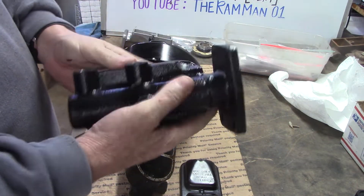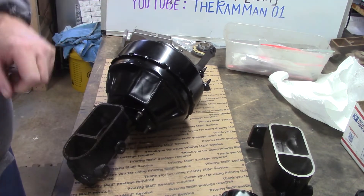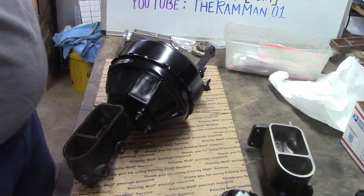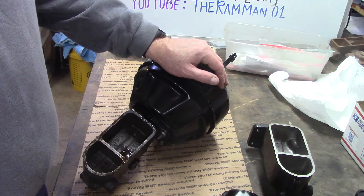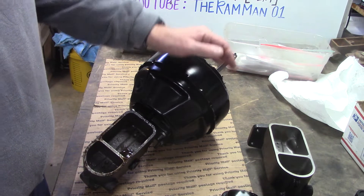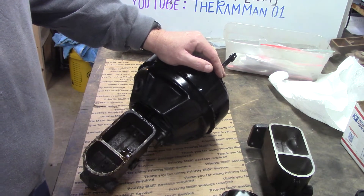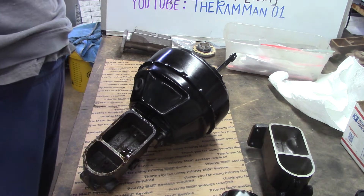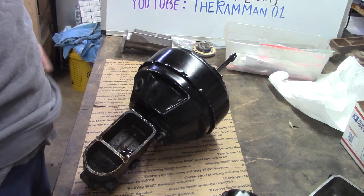Moving on from that, we have the Bendix Tandem Bendix Booster. What does that mean? That means there's literally two boosters in here piggybacked on each other. This Bendix Booster was introduced in 1962 on the Imperials. The Imperials used a great big inch and an eighth drum brake master cylinder, so they wanted a big old booster to push that big old bore and they wanted it to be soft and comfortable. The Imperial is the flagship of Mopar — they spend all the money and all the research and then it trickles down. An Imperial is much, much different than a C-body. An Imperial's first class; they basically run it on a D200 chassis.